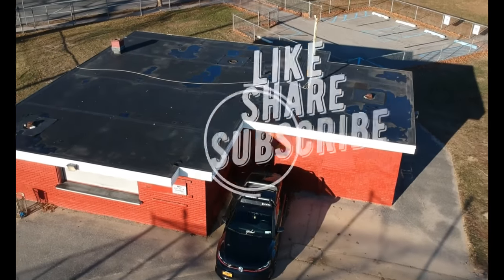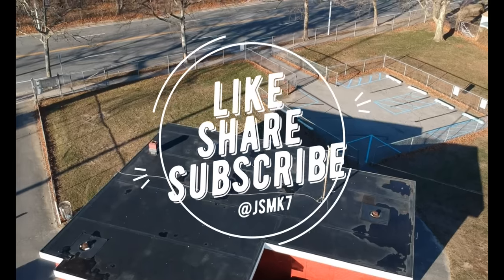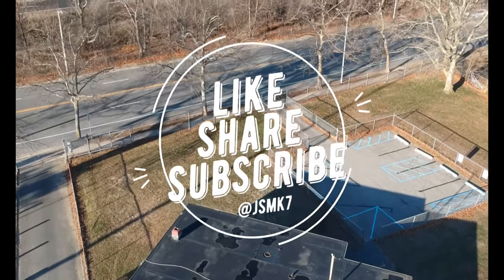We're reading boost — which is good! Just make sure that when you're putting the boost gauge into the pod, you don't push it all the way back because you can pinch the hose and it won't read any boost. Other than that, thank you very much for watching, and thank you to Air Force Technologies for sending this over — I'll put the link in the description below. Make sure you like, share, and subscribe. We've been growing quite a bit lately because a lot of you have been sharing the content, so thank you very much. See you in the next one!